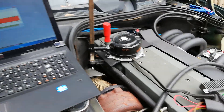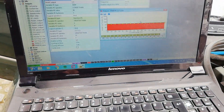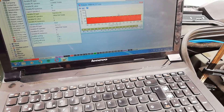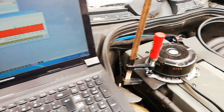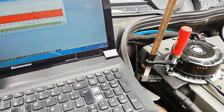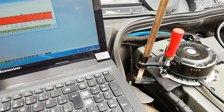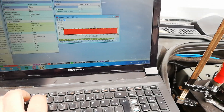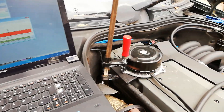The ECU outputs a 15 Hz PWM signal ranging from 10 to 90 percent duty cycle. I'll show you quickly — it's now at 90 percent, but the signal is inverted, so 90 percent here is basically 10 percent where the motor isn't spinning.